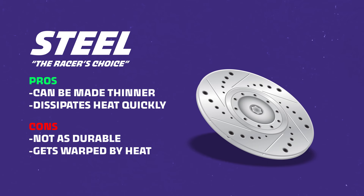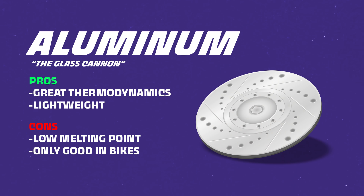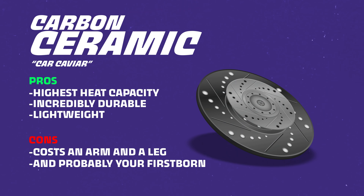Wilwood Engineering has been designing and building performance brake components for 45 years, making everything from high-performance pads and big brake kits for road cars to fully custom setups for racing. Most brake discs are made from iron — cheap and effective but heavy. Some race cars use steel, which can be made thinner, lighter, and has greater thermal conductivity, meaning they dissipate heat faster, but steel wears quicker and is more prone to warping. Aluminum dissipates heat better than steel but has a lower melting point, so it's only used for lightweight applications or as the hub component of a two-piece rotor. Carbon ceramic is used on some of the most expensive performance cars in the world, like the Bugatti Chiron and Rimac Nevera — carbon brakes can be as much as $21,000 to option on a Porsche 911 Turbo.